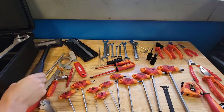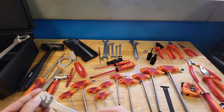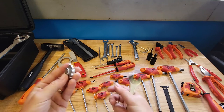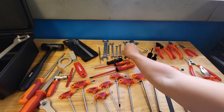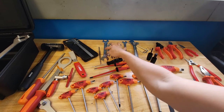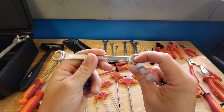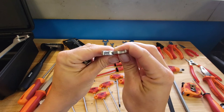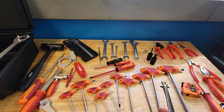There's a magnetic Shimano tool — it's a 13mm, which is the Shimano lock ring size, so they have that covered. They have box wrenches in double-ended format to save space — a 13 and 15 combined, basically every size doubled up. They also included a deep 10 and a deep 8, which is great for those disc brake lock nuts. You can see the difference in depth, so when you're doing disc brake hose lock nuts this is actually really nice.